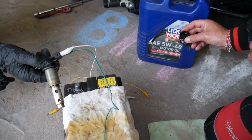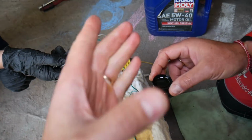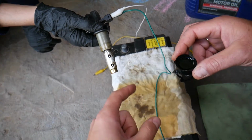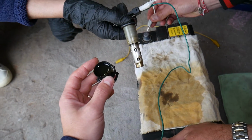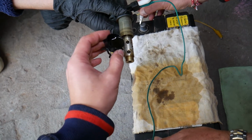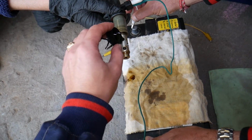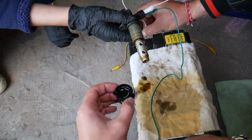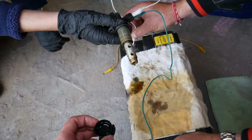Next, we're going to get a little bit of engine oil. We use Liqui Moly, and we'll put the link in the description of the video below. That's the oil that we use in our BMWs. It works really good. We're going to apply a little bit of oil and open and close it so we can lubricate it before we install it back on the car. So let's go ahead and do that. I'm just going to pour a little bit of oil through the holes. Move it again. To make sure, you can still see some dirt coming out, but it will definitely be a better working Vanos solenoid after that.